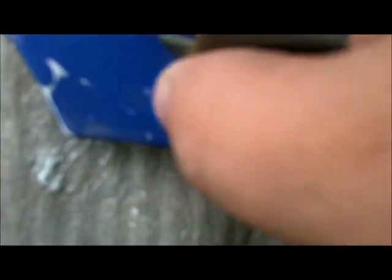Now I'm going to jump to 800 grit, keeping the paper nice and wet. Then we'll jump to 2000 grit — I'm still concentrating on where the putty is. This is where it gets a little tricky, because if I go through, that's it — we're going to be repainting either the whole hood or the corner of the hood. It's really hard to blend a hood. Just got to concentrate on just where the putty is — just sand the putty if you can help it.